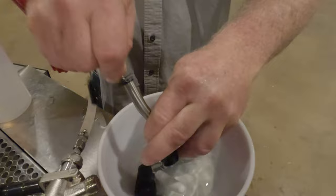Now just put the faucet back together, put it back on, and you're done. As you can see, this cleaning kit is very easy to use and will get your beer lines nice and clean. I recommend cleaning every two to three weeks, or at the very minimum each time you finish a keg — clean the line before putting a new keg on. Again, this is Keg Connection's beer line cleaning kit, and we appreciate you learning how to use it today.